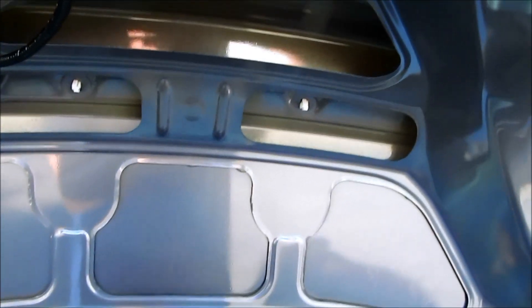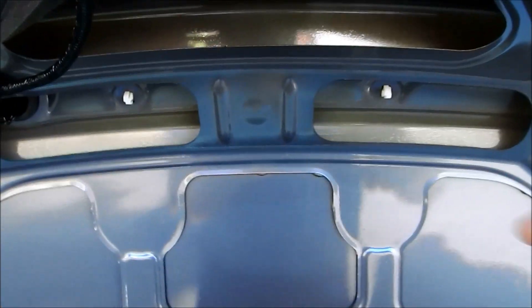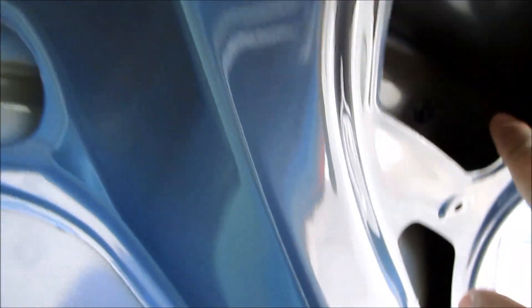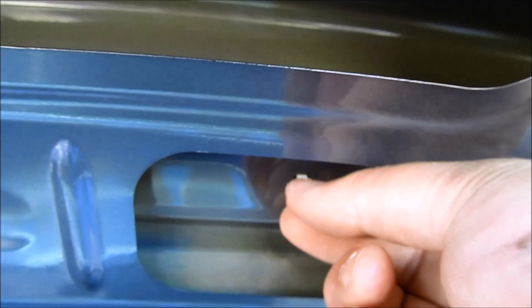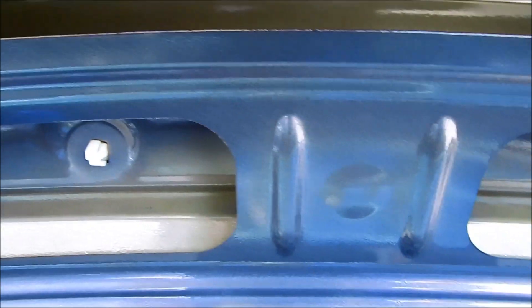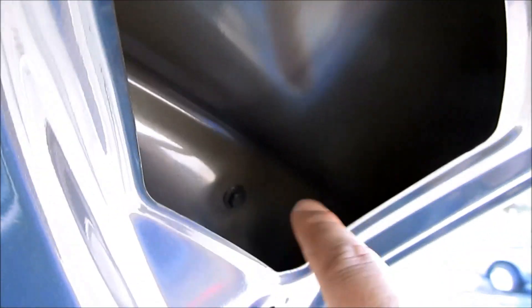Using a pry tool, you'll notice it won't come off all the way. The reason is it's held on by these clips right here — there's one here, one here. There are two behind here and another two behind in here. You can see there are two right there, and if you look in that little opening there are two right there as well. You have to release those. It's pretty simple because they're easy to access — just squeeze the top and the bottom and push it out and it will pop out.